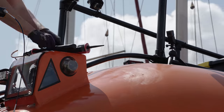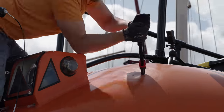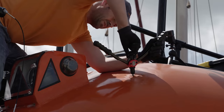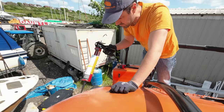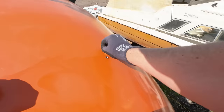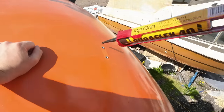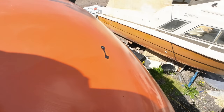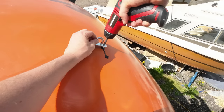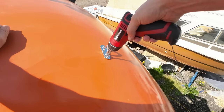Rivet nutting commences. I'm still a beginner, and it's harder than normal pop riveting, as you need to make sure all the angles are perpendicular, and there's no satisfying snap on completion. You seem to need to judge when there's enough expansion behind the glass shell — too much, and perhaps I could damage the shell. Back out with some more sealant, just basic polyurethane this time, with the same thought process: some to squidge under the metal once bolted down, some around the holes, some inside the holes, and some under the heads of the bolts to complete the seal.